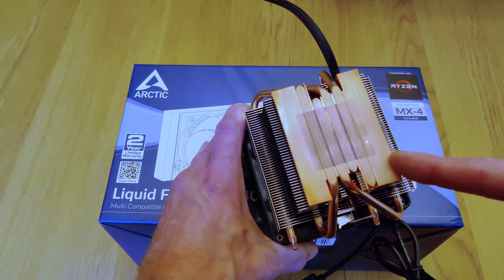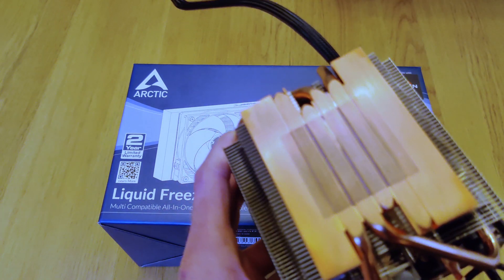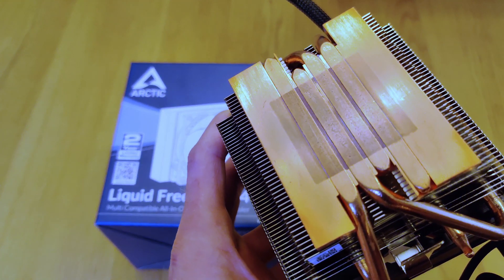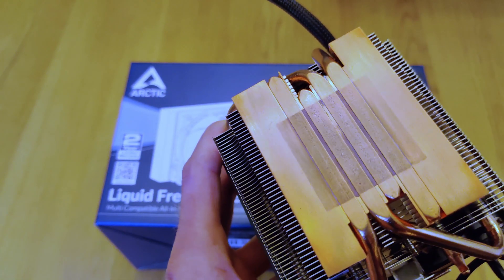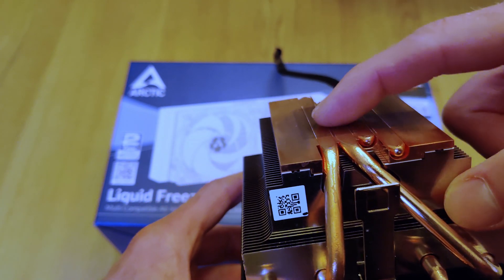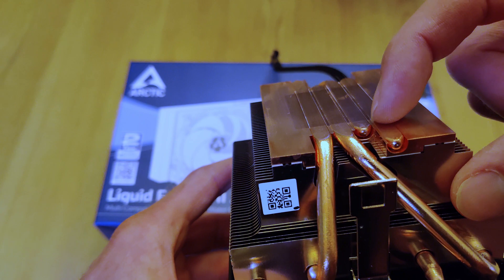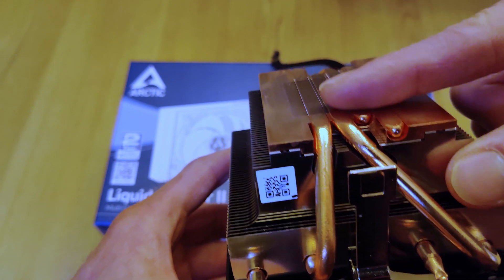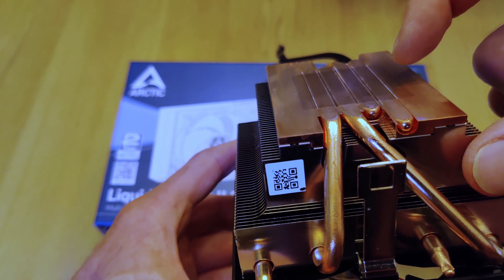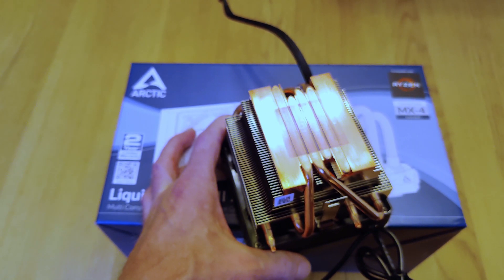This should be flat — a clean, shiny surface. Because all of these little holes — let me focus in on that — those are places where you can see where the thermal paste has gone in, and the thermal paste has to cover each one of these little holes. And even worse than that, if you look here, you can see these deep grooves in between the thermal pipes and the copper filler that they put in here. This is not flush at all.